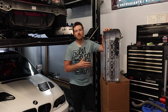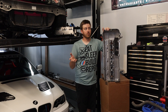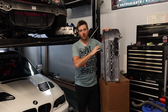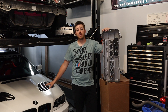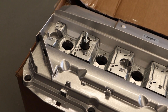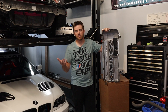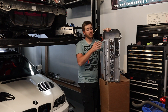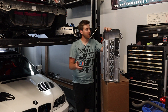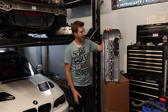These are cheap — I couldn't believe how inexpensive this was. I do have an M56 valve cover; those sell online for around two to three hundred bucks used. What's nice about those is the CCV system is all right there, so you don't need the original M54 system. The reason I didn't go that route is because I wanted to do a catch can system. These are so inexpensive that I was worried they'd sell out — when I saw them I couldn't believe they were only 170 bucks. You can spend more than that on an OEM plastic one. I bought two because it kept saying there were only five or seven left in stock.